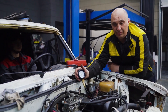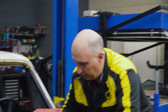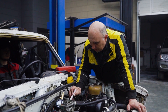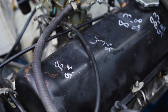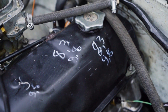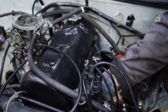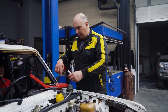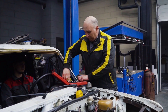We know that the compression was nice and even before, and it's still nice and even after. Let me just write this down — 9.8. Now let's start the engine and see what happens, whether anything breaks, how long that takes. And after the break-in, we do another compression test and perhaps a bit of hard driving to see if the ring lands break. The plan is to do some testing and see just how reliable all of it is.